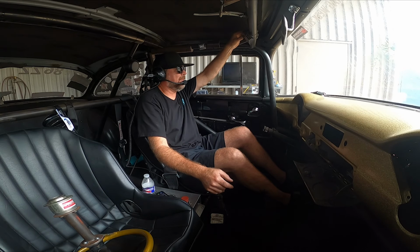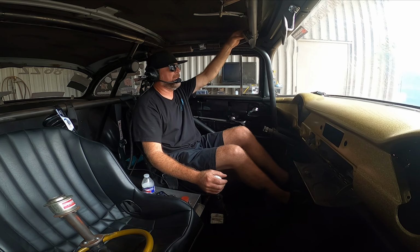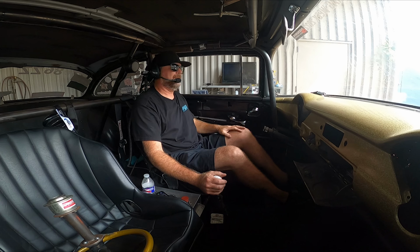Warm up the car. We have the party pulley on. Let's see if she'll make some beans. We've also taken the safety out of the ECU, where if our air inlet temp goes over, say 250, before it was pulling timing, now it's not going to do that. We have good racing E85 in the tank with 112 octane. This should make about 17 or 18 pounds of boost. This should put us over 1,000 with any luck.